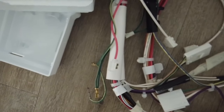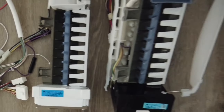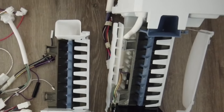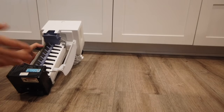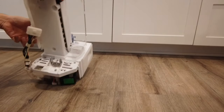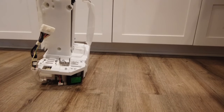The new ice maker has a different wiring adapter, so you want to switch those out as well. This attachment here is the same, so we won't swap that — that's for the on/off. Once your ice maker is full, it lifts up that rack. Start on the bottom of the ice maker and unscrew those three bolts — those are six and a quarter.